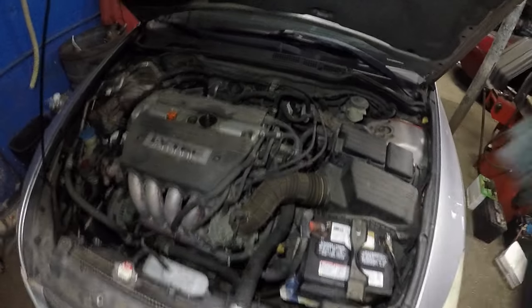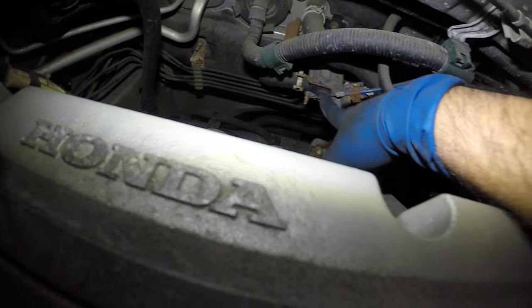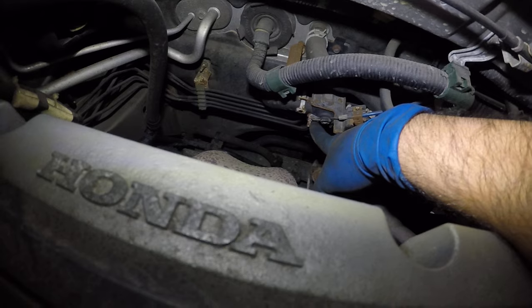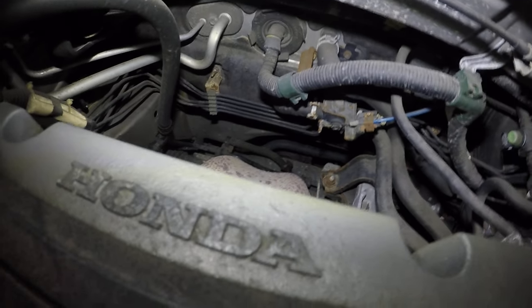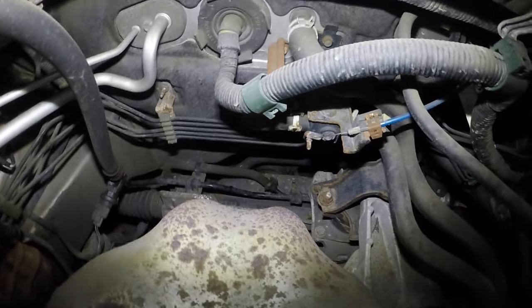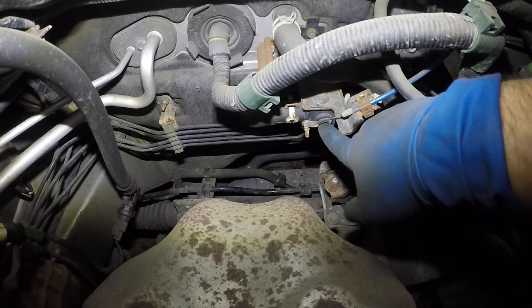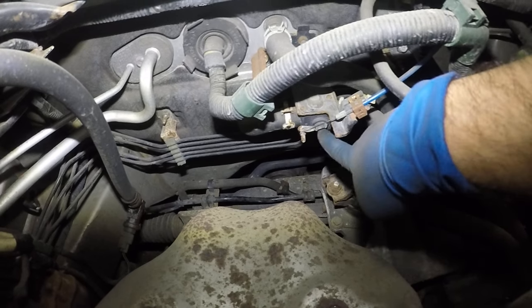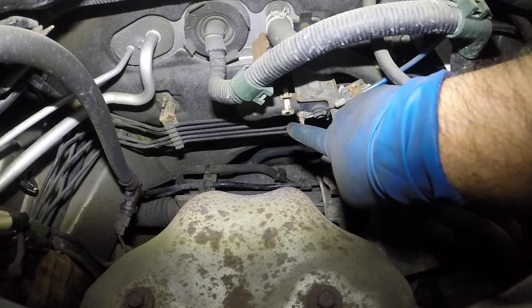The valve I was telling this viewer about — this is what I'll be looking at. You see how this is up, you see the angle it's at right now. This blue cable here — let me bring the camera closer — this blue cable, if you turn the knob to heat, this cable should push this arm over here.